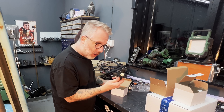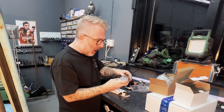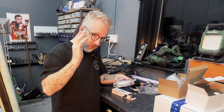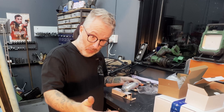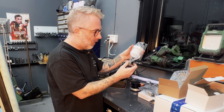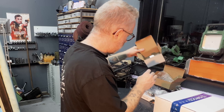Then there is a six-pole battery main switch safety thing for the wiring. And there is also a brake balance setting so I can modulate the brake balance between rear and front, which is important because the weight distribution of this car is super weird — like 99% is on the rear wheels. And the front and rear wheels have the same calipers — both front wheel calipers — so it's important to be able to set that. There's also a brake fluid reservoir for the front brake handbrake.